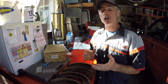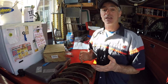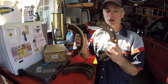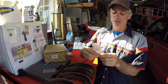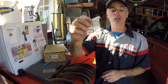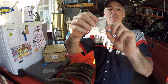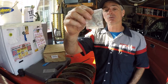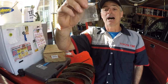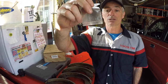Jordan chose to go with OEM Toyota brake shoes. We've heard on numerous Toyota forum threads that people have had better luck going OEM with brake shoes — we suggest going OEM. The OEM brake shoe kit comes with C-clips, and the Toyota factory service manual recommends renewing these — you don't reuse them because you bend them when putting them in place, which fatigues the metal. The kit also came with two E-clips, and since they came with the kit we're going to use the new ones.